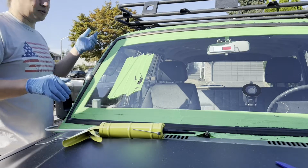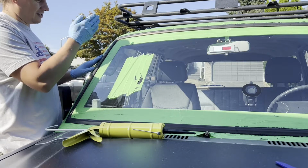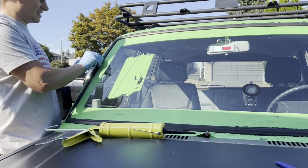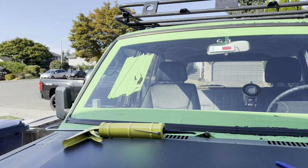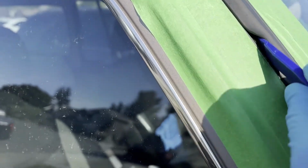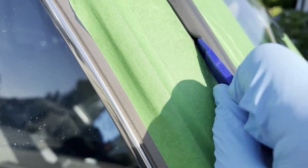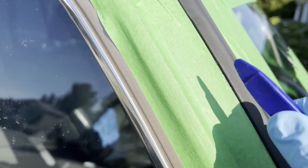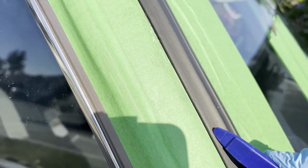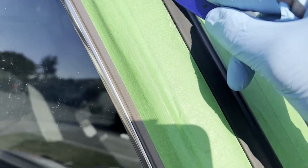Well, here I'll show you guys where I'm trying to get it. Since the gasket, the surface of the vehicle kind of stays flat there, and then it dips down to where the edge where the gasket sits in. We just really need to get the sealer just on this outside edge, because you can see the tip of that kind of sinks down back there. You don't need to go all the way back there. You just need to get it on this outside edge right here where it's working, and then that'll seal on that outside quarter inch of the gasket, because everything back here, water gets back there, it's in a bad spot anyway, so we want to seal around this outside edge.